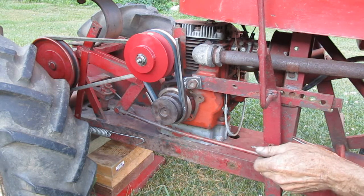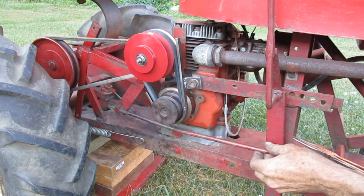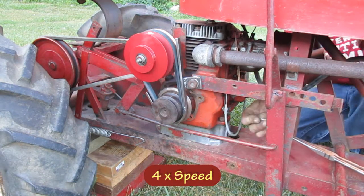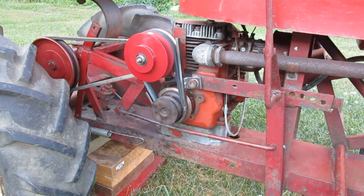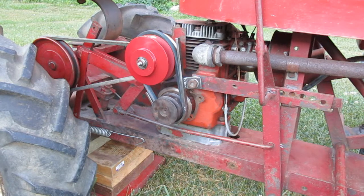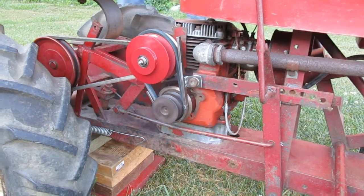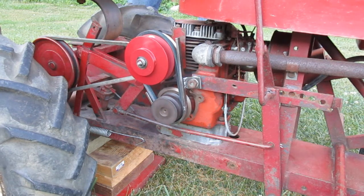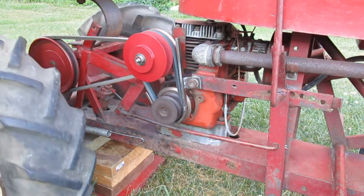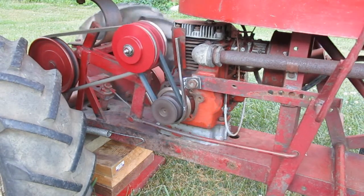To adjust it, I'm going to take out the front part of this bar and screw it out two turns so it's a little bit longer. Then when I'm in the neutral position hole, the pulley will be slightly lower. Now in neutral I can turn the engine pulley and the belt doesn't grab — so that's good. And if you move it to the first hole, it appears to be fully engaged and not slipping.